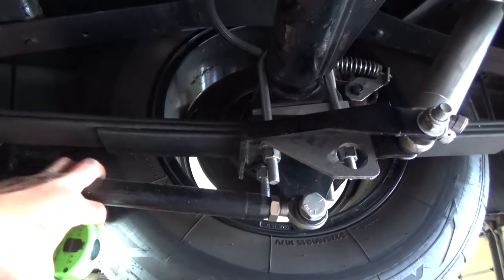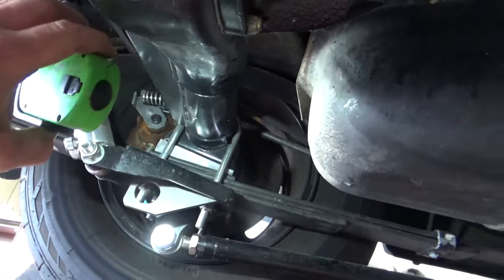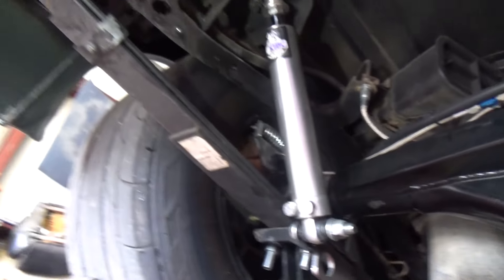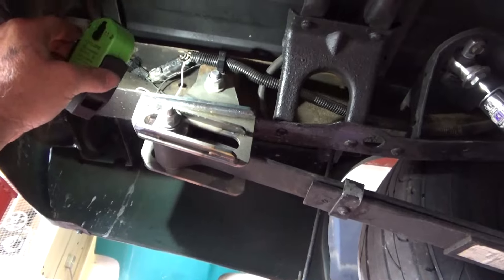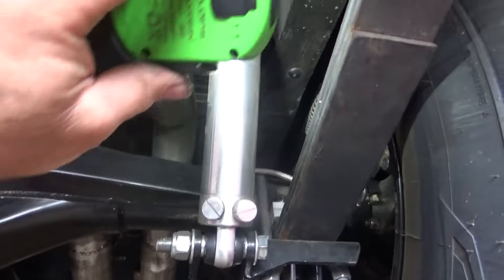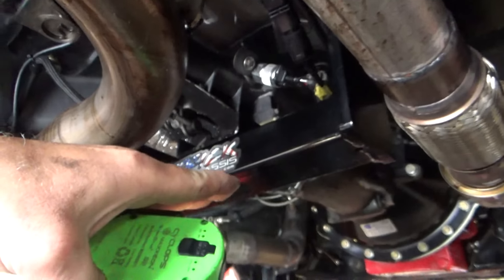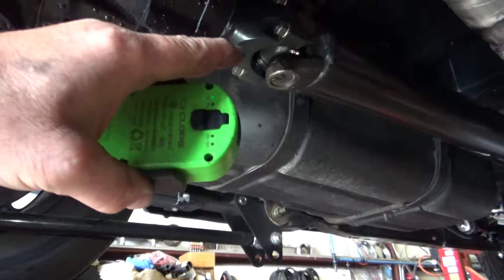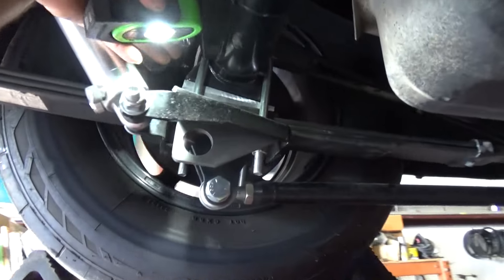Cal tracks. I'm going to say we're probably going to remove all of the shims. Motion Race Works driveshaft. Nice rear — Quick Performance rear axle, disc brakes, Viking dual adjustables in the rear. Those look like Funkhauser rear slides. Nice sum of parts. You're probably going to want the Funkhauser anti-roll bar too at some point when we get this thing hooking up. I can see our engine and transmission are in a downward angle, and you want your pinion angle to be the same angle. This one the pinion angle is actually pointed down, so I'm going to start by taking out the shims.